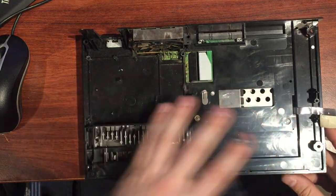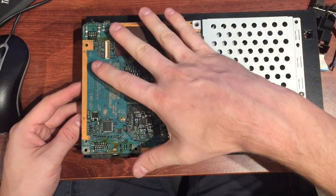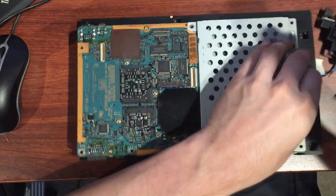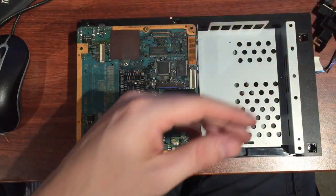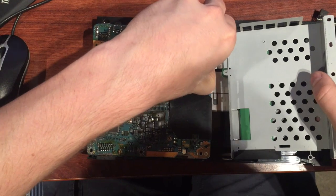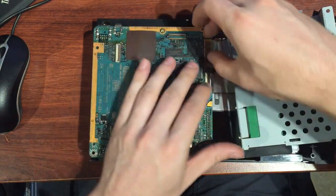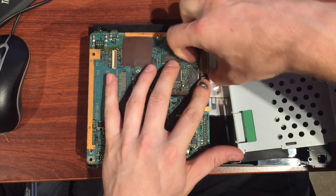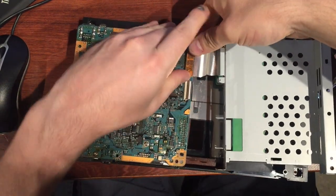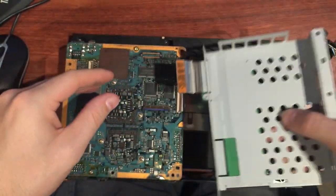This thing's getting much lighter. The fan is filthy. I'm going to work out how to get the plastic separated from the board. I think we'll flip it and do it from the bottom — lift off this tray, then the board with these screws. Let's pull this screw out here, that one comes out the side. There's a little ribbon here that just lifts up — very carefully wedge that underneath and lift it up.